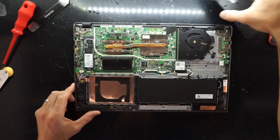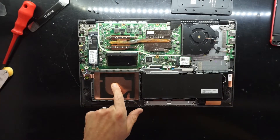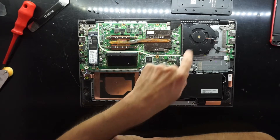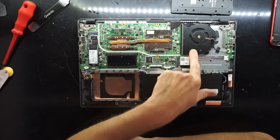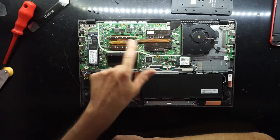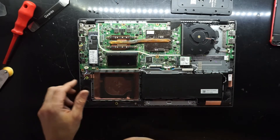I'll just make a bit more room here so I can slide the laptop around to zoom in. To begin with, we have a vacated 2.5 inch slot, an NVMe slot, a single assumably DDR4 RAM slot, a Wi-Fi card, and a replaceable CPU fan — or main board fan, I would almost classify that as. There's no copper pipe directly connected to it; is this passively sharing heat between what I'm assuming would be the CPU and the GPU? And a very small battery down the bottom here.